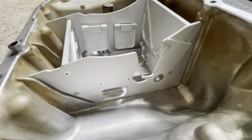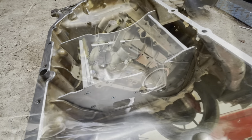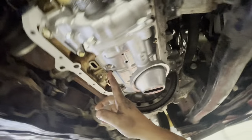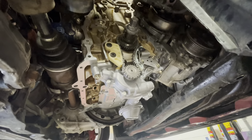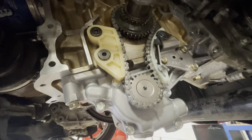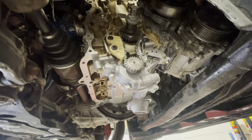And the oil pump's in. The oil pump's in, the chain's on, the guide's in. Okay, let's have a look at the oil pump. There she is — you can see the new tray. Yeah, so obviously we've put the bolt in and torqued it down to blank off the oil gallery. We've got a new windage tray, obviously new oil pump, new chain, new guide, new tensioner. So that's in place. We'll go for refitting the sump next and then we'll move on to the chain — so that's the actual timing chain itself.